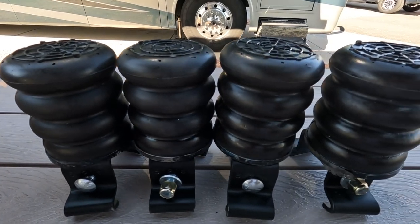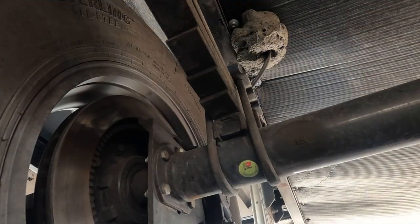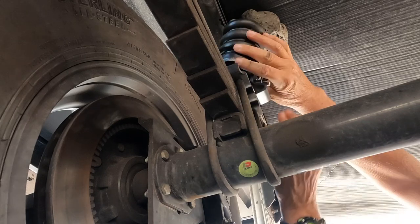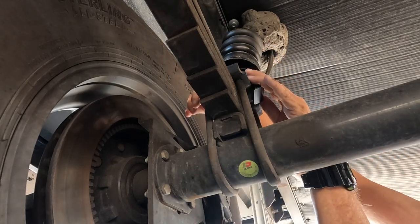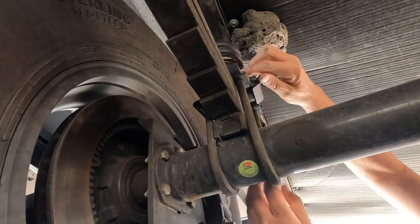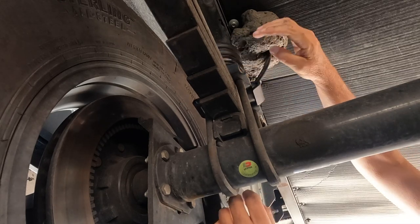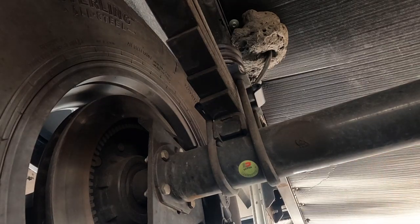The preparation was very easy. Just measure the distance between the top of the axle and the frame, put them together with the right clamps in the right position, and then check to see if you need to re-home any of the hydraulics, brake lines, or propane lines. Once you have them assembled, go to the bottom of the RV and mount them on top of the axle. Estimate to make sure that when the frame is dropped, it makes contact with the Sumo Springs, then tighten down.